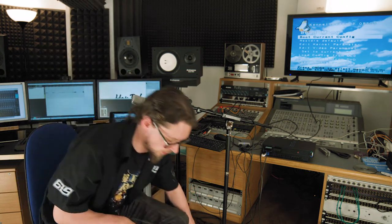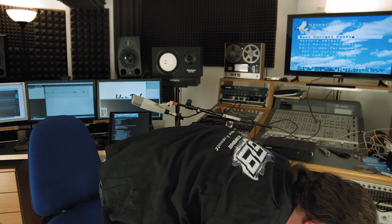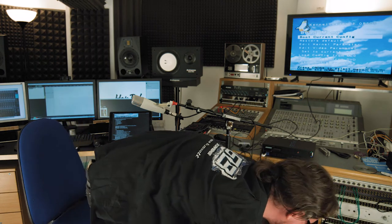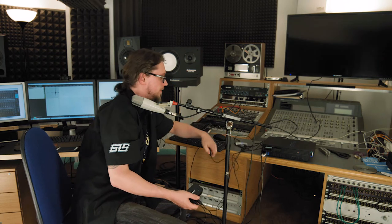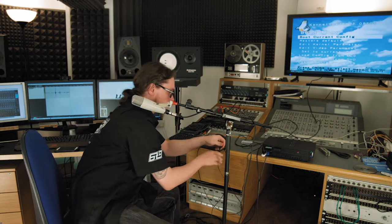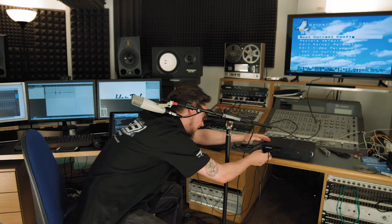Okay, this is a problem that I had before. So what I'm gonna do just for now, because the PS2 to HDMI thing doesn't need a data connection, I'm just gonna power that off of a completely separate powered USB hub, because that doesn't need any sort of data connection, and then I'm gonna plug the keyboard straight in and see if that does the trick. See if it's this USB hub, or at least even the idea of a hub, that's screwing it up.